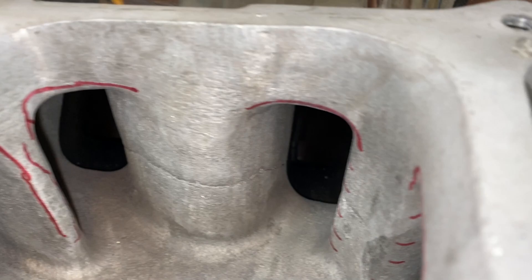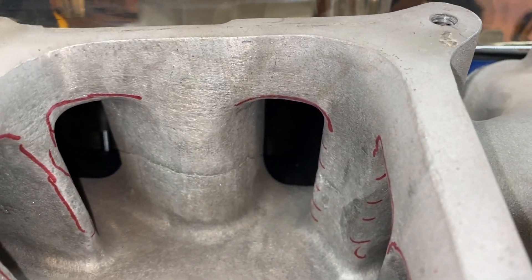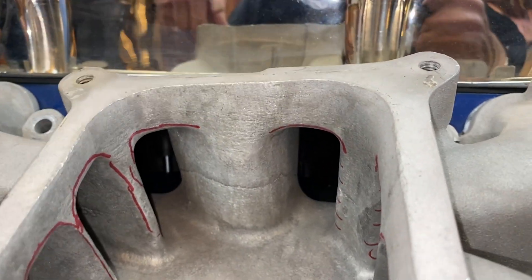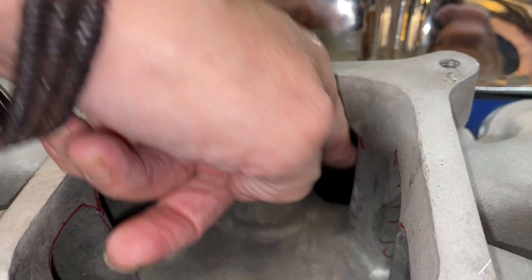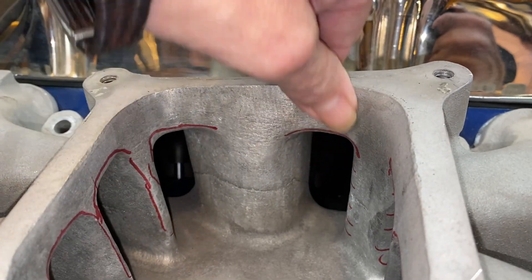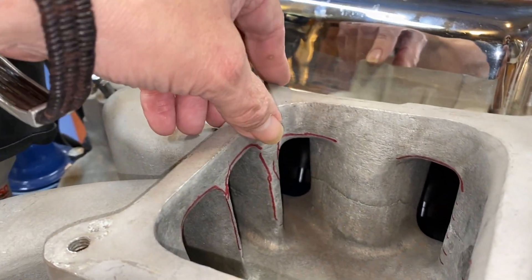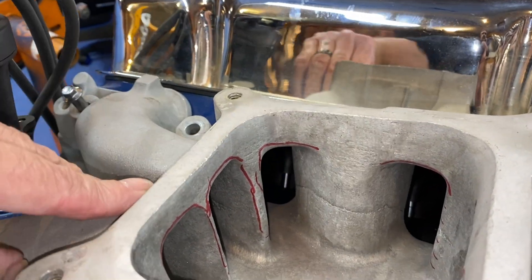Looking down in here — let's see if you can even see. There's the valve there. Does that look like a straight shot to you? I know I can fix that and make it better. When I look down through the carburetor with a light, I can see that all this area needs to be radiused. Smooth down in here. This big piece right here — got to get rid of that. That's almost a 90 degree right there. You can see the other valve in there.